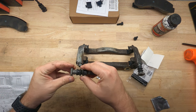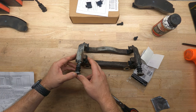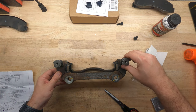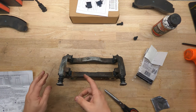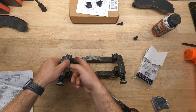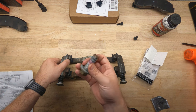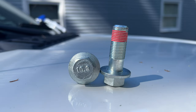So with these pins I'm going to replace them, put the new boot on, pull the boot over it, and pull it together. Now that both of these are together, the flat spots need to go parallel per the instructions. Then I'm going to add some grease to the bracket contact areas to get ready for the pads. I'm not going to put the pads on until I get the bracket back on the car. And for these bracket bolts, we're actually going to replace them with new ones — you're only supposed to use them one time. So I got some new ones from AutoZone.